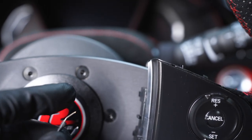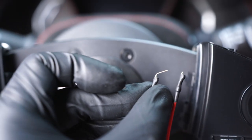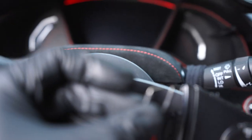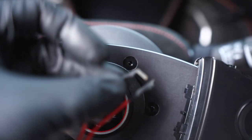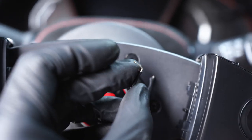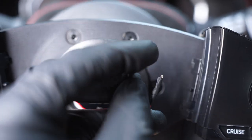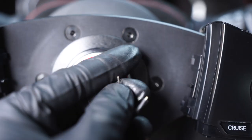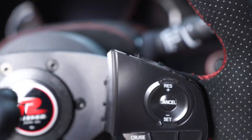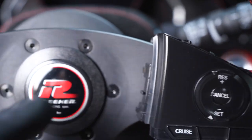To show you what I mean by plugging them in the proper way — you'll notice there's a little indentation for them to fold, so you want to plug it in like that and then fold it down this way so it'll be cleaner. If you plug it in the other way and fold it, it would snap. Look — if I plug it in the wrong way like that, it's already about to snap. There it goes, it just fell off in my hands. So make sure you plug it in the right way, fold it downward, tape it up with electrical tape, get it nice and secure, and then basically just stuff it in there.